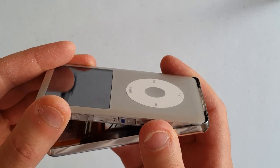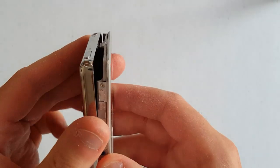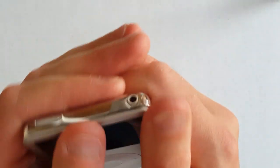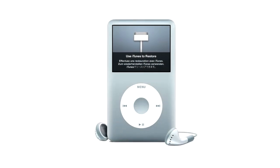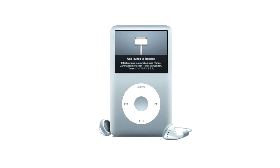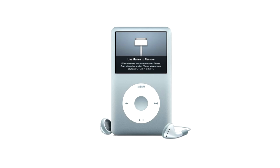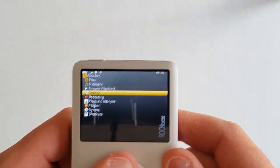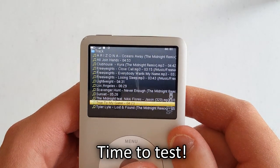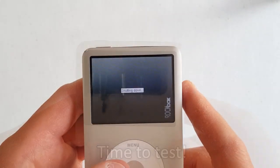Now just bring the two halves of the iPod together and push the front face into the back housing. You should hear some clicks as the clips pop back into place. Then press down on the edges to make sure you didn't miss any spots. Please note that if you are installing the iFlash and storage media for the first time, once you power on your iPod again you should be prompted to restore your iPod from the iTunes app on your computer. My iPod Classic has the Rockbox OS installed on it, so it boots up and runs a little differently than a stock iPod. Just do some testing — press the buttons to make sure they all work and load and listen to some music. And you're all set!